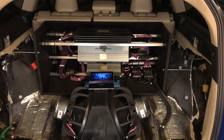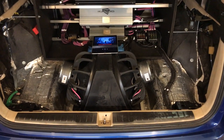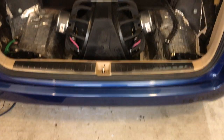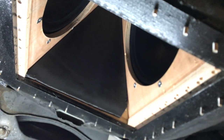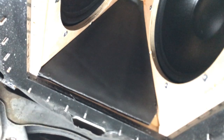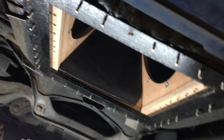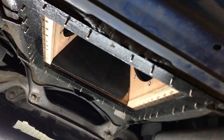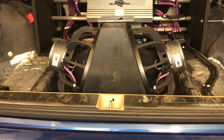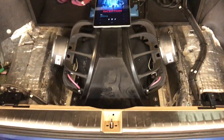They don't produce much until the tailgate is shut. Once it's shut, the inside of the car becomes your box — a big, big box. The other side of the subs is the outside space, which is infinite. The subs are breathing to the outside, and that construction is ported to an 18mm steel frame which is welded to the floor pan. That is solid, and that's a fundamental criterion — this structure has to be as solid as possible.